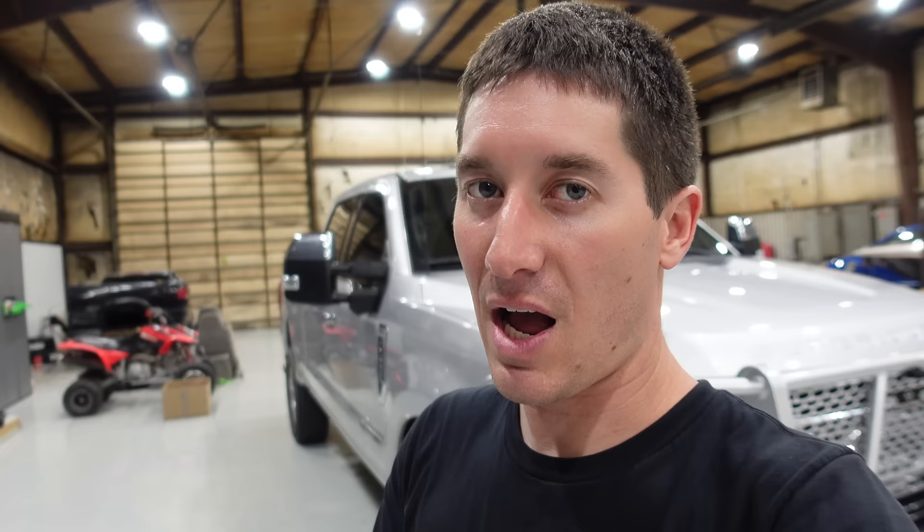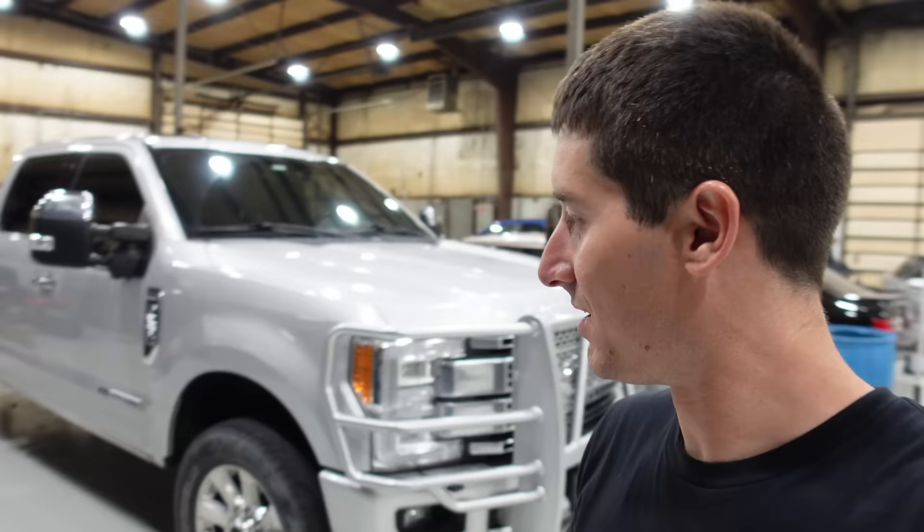When I get new tires I feel like the truck will drive like a new truck again, and it's probably time to do an oil change too. That's what we wanted to see out of the brake job — nice and smooth, no noise at all. This brake job was $800 for just pads and rotors. I'm sure the Ford dealership wants like double for the install, so it could be a $1,600 brake job. Re-torqued the wheels at 140 ft-lbs. The caliper bracket torque is 203 ft-lbs and the caliper slide bolts are 55 ft-lbs.